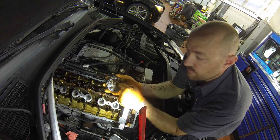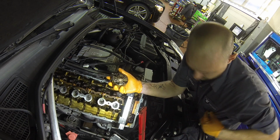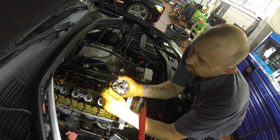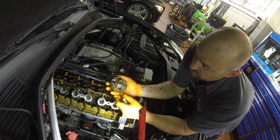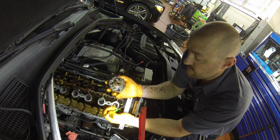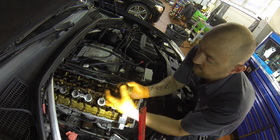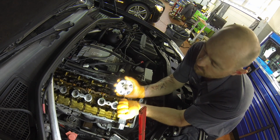This thing works like this: oil pressure flows in here. It works on this side of the vane to open or advance the camshaft. So that works. Advances it. Normally the outer section is driven by the engine. The inner section is attached to the camshaft. Oil pressure flows in, and this is the intake, so it advances the camshaft. It rotates that way. So this all rotates that way.